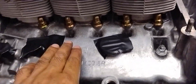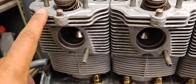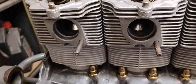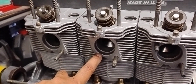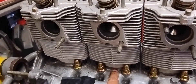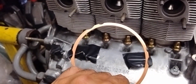You can stack cylinder base gaskets. I know they say you should never do it. When these come from the factory they normally run with a 0.25mm thick gasket on the base, which is very thin and pretty standard. The theory is that when you rebuild an engine, the first thing they'll do is machine all the heads down by 0.25 of a millimeter for the sealing surfaces. So if you machine 0.25mm off, you need to put the head back to where it was, otherwise you're reducing your dome volume, increasing compression, and could potentially have piston-to-valve interference. The factory then sells you a 0.5mm thick cylinder base gasket — a little copper gasket — to compensate.